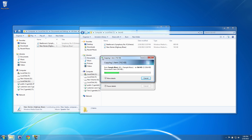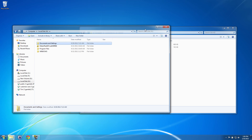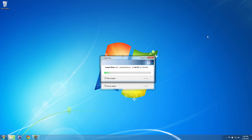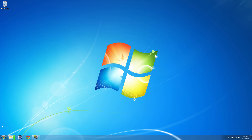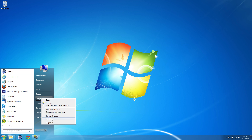The other thing you can do is open the windows side by side and drag between the two of them, so you can go here and just drag it over and that's going to copy it from one to the other. That's a little more complicated — you have to have both windows open and kind of manage and remember, okay, that's my C drive, this is my H one. But you can drag and drop between files, between the two hard drives and folders. Now, there may be cases where you see the hard drive doesn't come up. There are a few reasons for that — the hard drive could be defective or the hard drive may not be initialized.